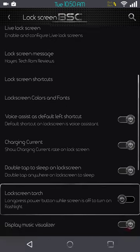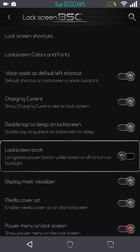You can have a lock screen message, voice assist, and charging current — that's a good one to have. I actually read on a video I put out a while back about slow charging on the OnePlus One. One of the nice things about custom ROMs is this feature: charging current shows you how much current is coming into your phone. If it's not somewhere around 1000 to 1500 milliamps, you have an issue with your charger, USB cable, or USB port.